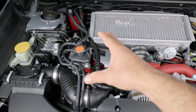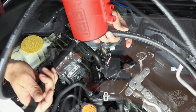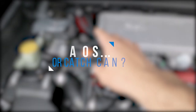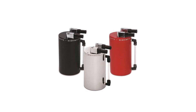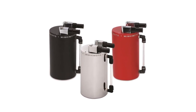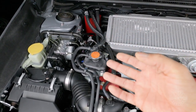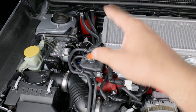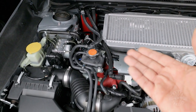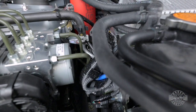It can seem daunting if you don't know what's going on — there are a lot of hoses, which is why it's lovingly known as the octopus. But once you know what they're all doing, it becomes much simpler. The air oil separator takes the oil out of the gases and dumps it back into the engine — that's how it differs from a catch can. A catch can does something similar, removing oil from the gases, but unlike the AOS it just collects the oil in the canister, making it a maintenance item you have to drain periodically. The catch can is simpler and cheaper, but the AOS, once installed, just sits there and does its job.